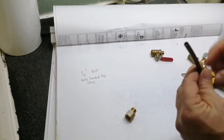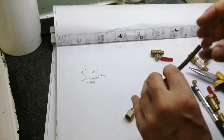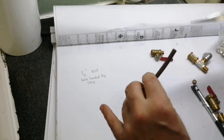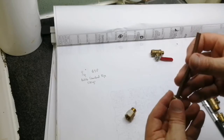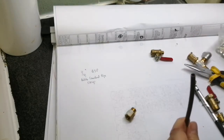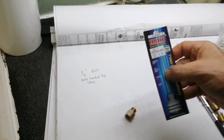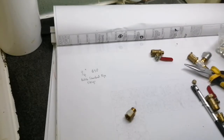The copper pipe — I just snipped the end. I was worried I didn't know how to do that, but in the end I just squeezed it. I was looking for a hole about a millimetre wide. I managed to squeeze it leaving two holes, but they were significantly less than a millimetre and I got very tight bubbles in my milk — it was too foamy. So in the end I closed it up completely and drilled it with the smallest drill bit I could find, which was about 1.19 millimetres. I'd like to go a bit smaller, but I need to find a smaller drill bit, or maybe I'll just squeeze the hole a bit with pliers again.